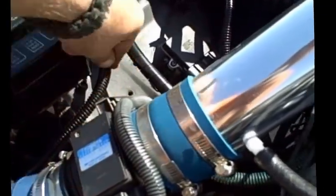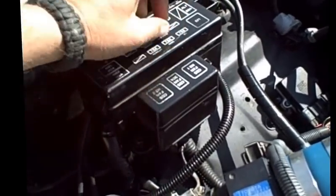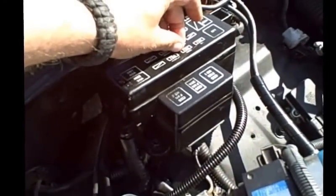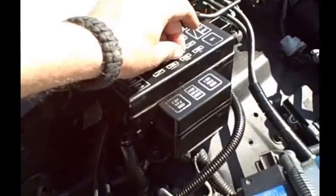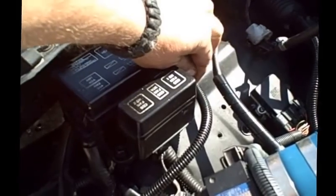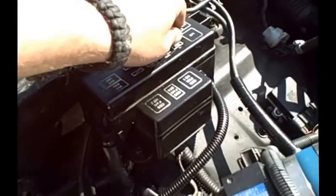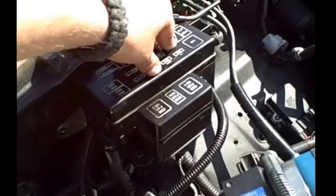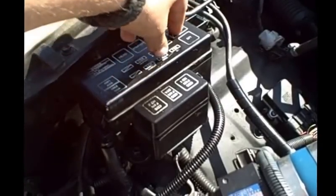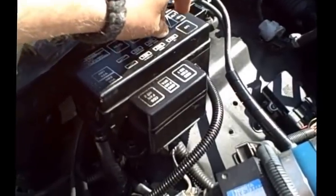Okay, back to the wire. This 4-gauge wire goes inside your fuse box. It's going to hook up to your 80 amp fuse. When you take it apart, you're going to notice a little flat square piece that the old wire used to connect to. Just go ahead and snip off that wire. All right, put an eye connector on your wire here. And just take off one of the screws that connects the square piece, and put it there, and that way the power of that is going to power both of those sections using that flat square piece.